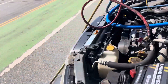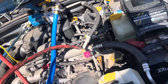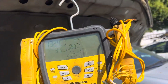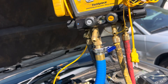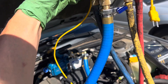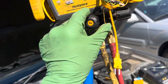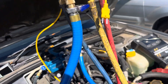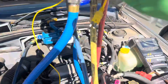So let's see what it does under pressure. It's a Subaru, and the first thing you always do is check the o-rings right here at the compressor because they always leak — and if they're not leaking now, they will. So let's push some nitrogen into the system. Because I have four manifolds, I can have vacuum and nitrogen hooked up simultaneously without switching back and forth and risking air contamination. I'll close the low side and feed nitrogen through the high side for a flushing sweeping action.